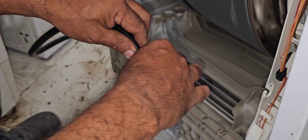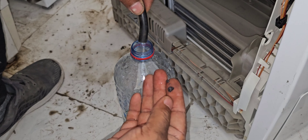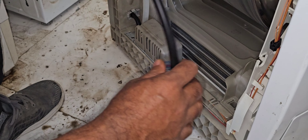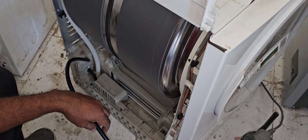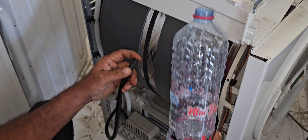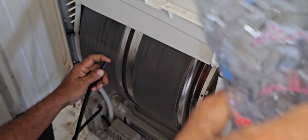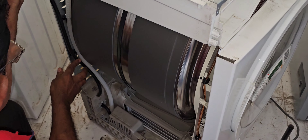Something is blocked here and we will clear it. You can see something has come out already. Now you can see it — the water here is very dirty and there is lint. That is what came out. This lint blockage was causing the machine to stop and show the error message. Now I will re-fix here.